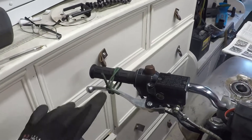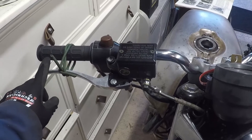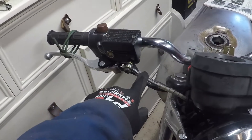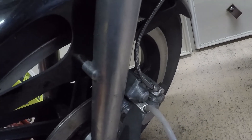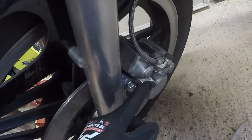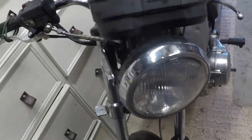Back on the brakes — trying to get these bled up. I've read your comments, so I'm going to try holding the lever in for a while. I've only just got out here so it's only been in for a short period, but I'll leave it for a while. In the meantime, I'm going to try and manually fill both the brake line and the caliper with brake fluid. I think the system being full of air is making bleeding far more difficult. I might just disconnect the brake line itself and try feeding fluid down from the top until it comes out the bleed nipple — I think that's my plan.